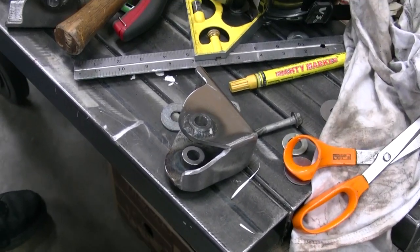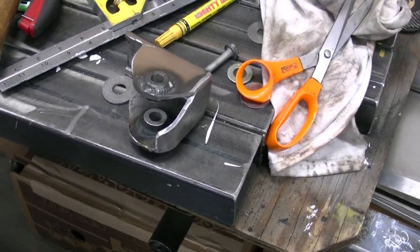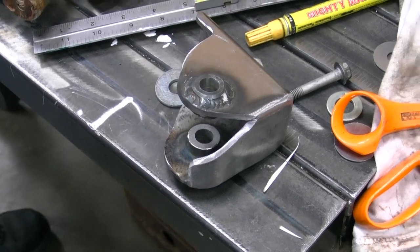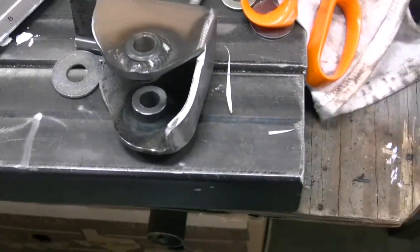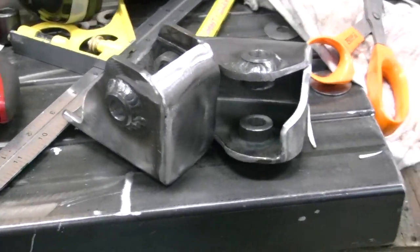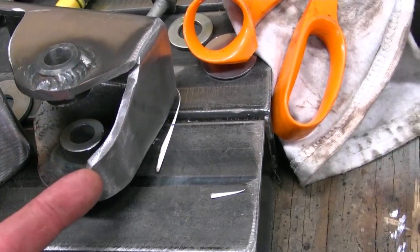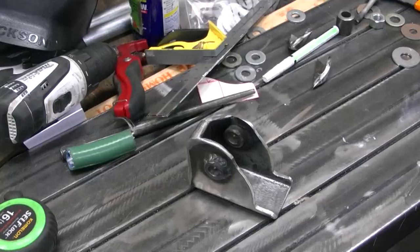We're currently working on the rear coil over bracket that welds to the frame. We're now at version three — we're having to cut a little pie slice out of it so it'll clear the kickdown where the trunk is in the inner rear wheel well area. We thought we had it all done, and you can see the pie slice we've had to take out of it to clear the trunk. We think we'll have enough clearance now. We're going to weld a piece of metal in here and retry it.